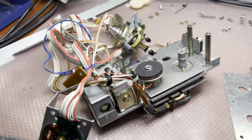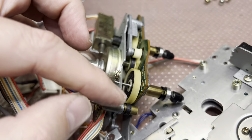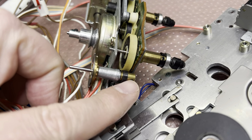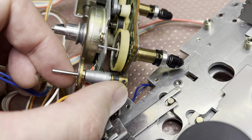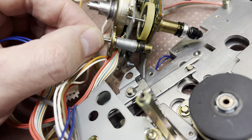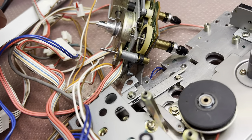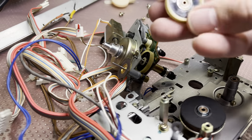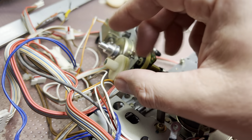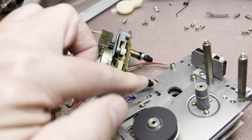I pulled up the reel mechanism - there you may see one idler here and another idler which needs to be replaced. The problem is I don't have the small tool - I have a 1.27 millimeter and it's not fitting, so it probably should be smaller. To pull it out and fully lubricate the shaft and bearings, I need a little bit more tools. Here you see how this magnetic friction mechanism works - probably the best mechanism I've seen. It should work very well when fully assembled and tuned.